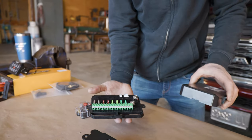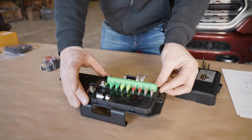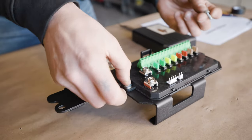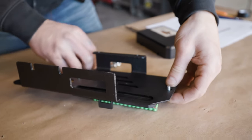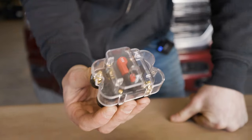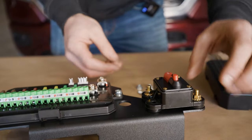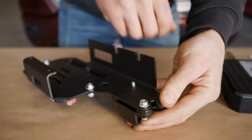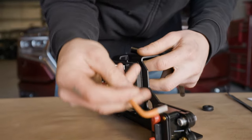Open the cover off of the switch assembly and line up these slots with the slots on the engine bracket. Using the shorter M6 Allen head cap screws and washer, insert those through the switch bracket onto the backside and retain in place with the M6 flange nut. Remove the plastic cover off the breaker and install onto the engine bracket with the longer M6 by 20mm hardware. Grab your 5mm Allen key and 10mm socket and tighten those down.